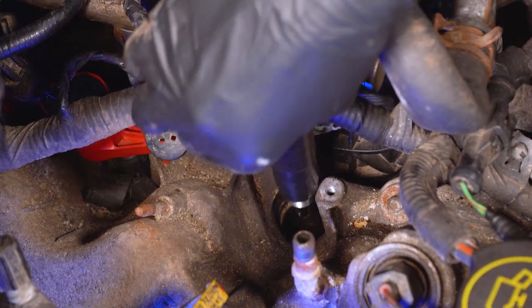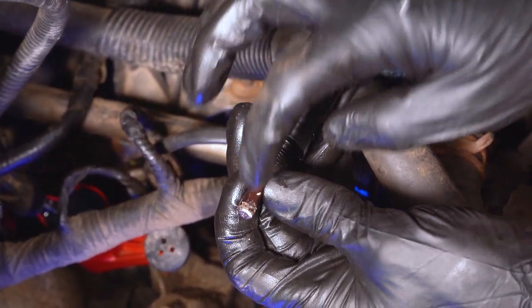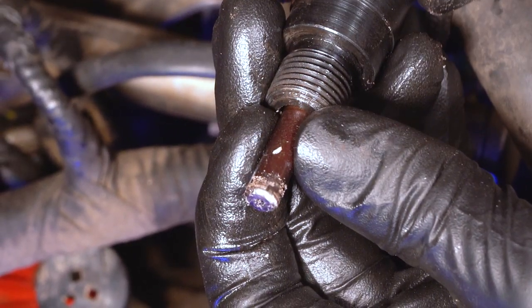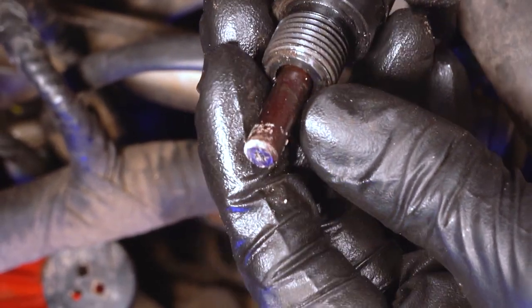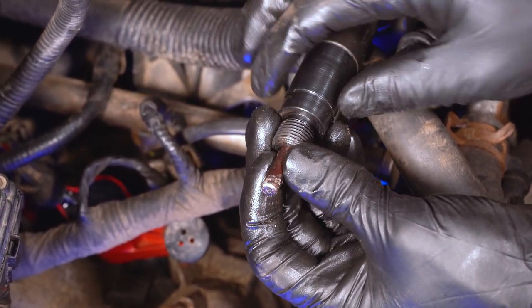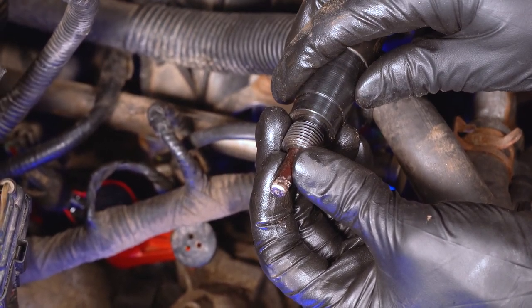Pull this insert out gently and you can notice how much ceramic there is on the tip of this plunger. This is exactly what you want to see — this is nothing to be alarmed about. It did its job: it pushed that ceramic through the sleeve. Even though there is ceramic dust here, don't worry about it. Even if it did get into the cylinder, it will just blow right out, but more than likely it's just on the tip here and did not make it all the way through.